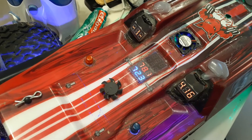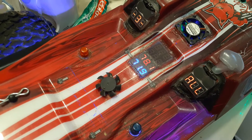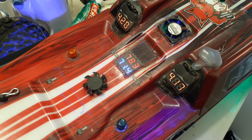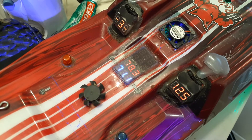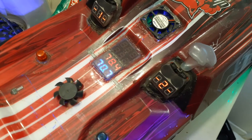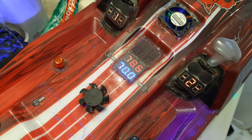I'm actually not going to let it cool down to 50 or 45 degrees. The lowest I got is 46. Because when it gets so cold, there's condensation. So I really want to be running it so it can warm up. I don't want to start having leaks. So I'm going to turn it off and wait until I get outside.